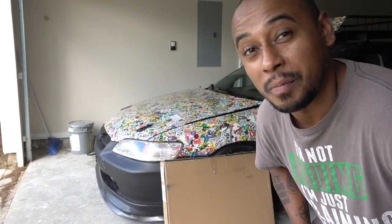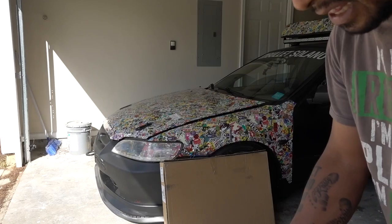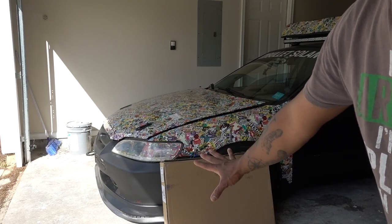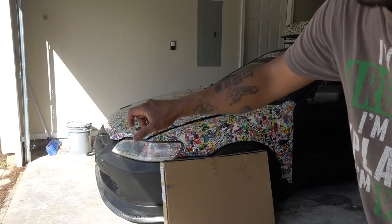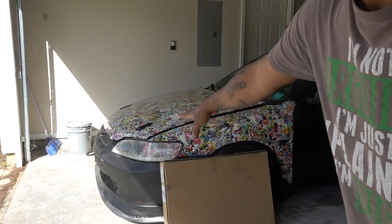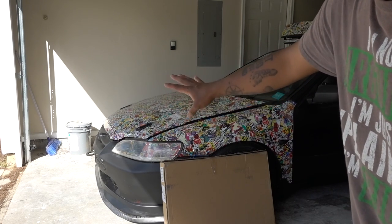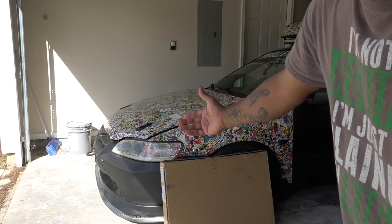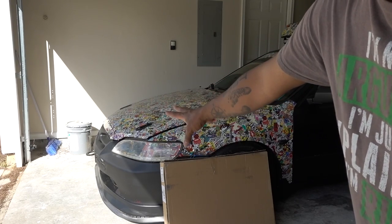Welcome to my first episode at the house. This radiator is from AutoSaber88 — the link is going to be in the description. I'm going to replace it on my car because mine has a small leak. These ones are plastic on top. This one is for a 1998 to 2002 Honda Accord automatic transmission, and it has a cooler for the transmission, so we have to remove two hoses from the bottom.